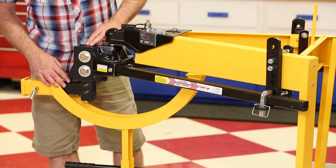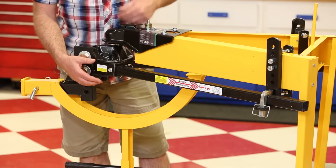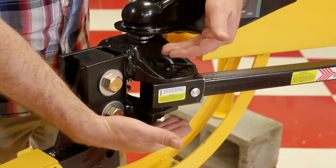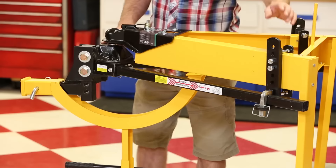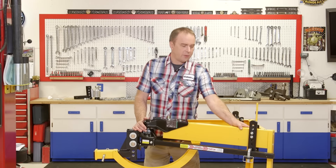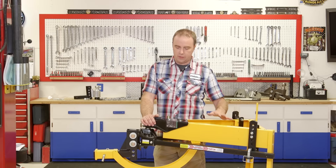Starting from the front: we've got the shank, with different shank options available to fit pretty much any trailer height and vehicle combination. The friction head is probably what makes this stand out more than anything — the bars are clamped between two steel plates, providing up to 800 pounds of anti-sway force. As the trailer moves back and forth, that force keeps it from getting out of control. Moving back, the brackets mount rigidly to the trailer and the bar is held in place with a pin. It's made for A-frame trailers and can be oriented in the underslung or normal coupler configuration, and there's also an option for a pole tongue adapter.